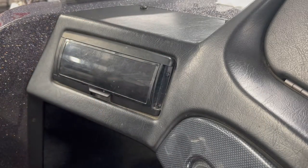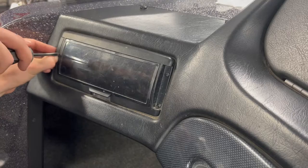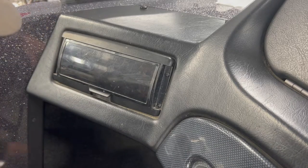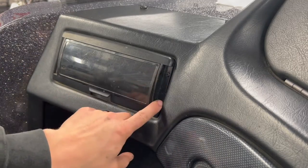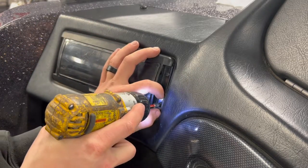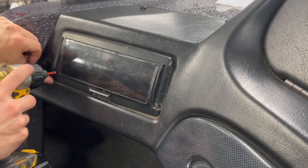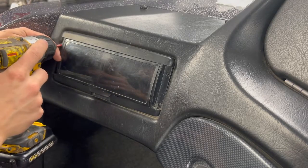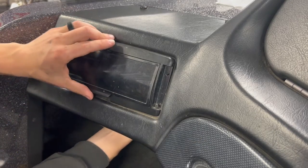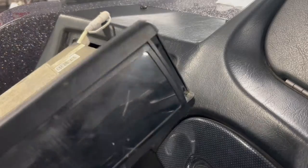There's just a tab on each side and they pop out — we'll go ahead and do the same on the other side. Again being careful not to mar anything up, I just use a flat blade screwdriver and take your time. There we go, those are off. Now we'll just take and remove — there's two screws here and two on the other side — and this whole thing will come out with the radio. So we'll go ahead and remove that. Now with a little bit of wiggling this radio should just come right out. There we go — no problem. So here now we're able to remove the entire radio as an assembly.